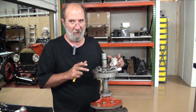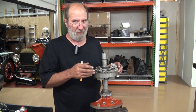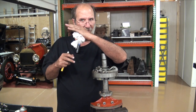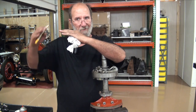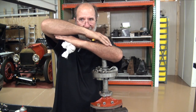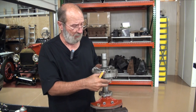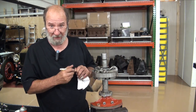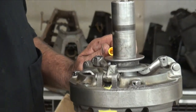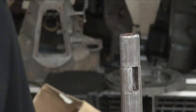I guarantee you somewhere along the line you're going to come up with something that's pretty sweet. And that's due to the fact that we chucked it up in the lathe and did the best we could indexing the thing in — it's rough-out material. So maybe we cut the drive plate this way and the brake drum this angle, and the drive plate was offset. Well, if you rotate that 180 degrees, they kind of fit together. It's an over-exaggeration, but in the real world that's probably what happens. So there are six holes — we find the best location. And the first thing I want to do is be able to know how I got it apart so I can put it back together the same way. So we index our brake plate and drive plate.